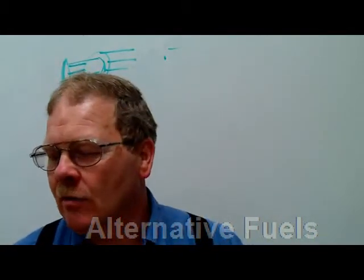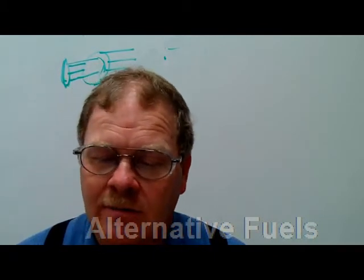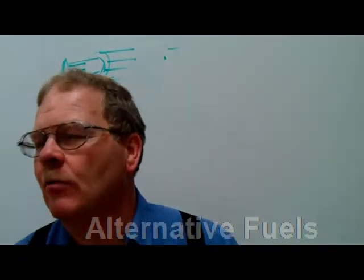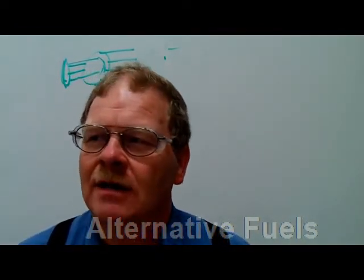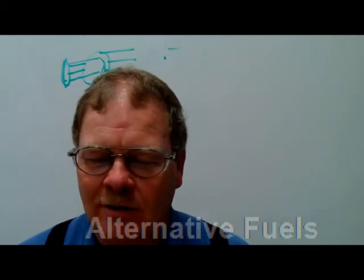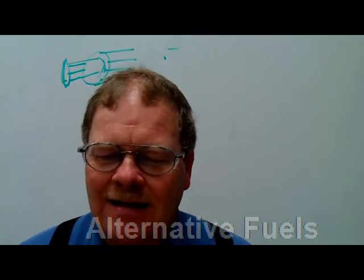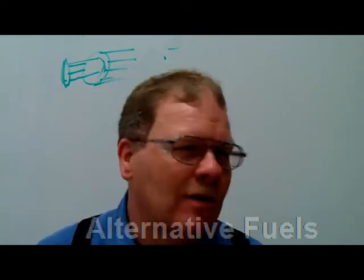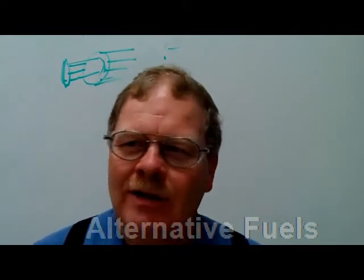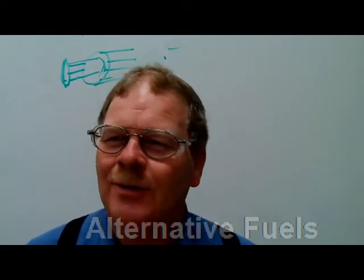They're supposed to say that over 10% alcohol in larger quantities isn't good for the fuel system. It sort of messes things up. But on the other hand, it won't run worth a toot either. Remember I told you I had this silly little weed eater engine I was fooling around with years and years ago down in Texas in the late 70s. I didn't have any gas on hand, but I had some Delco D-Clean, which is nothing but denatured alcohol colored purple. I was trying to run that thing on alcohol because I knew alcohol would burn. But it was running really lean and wasn't worth it.